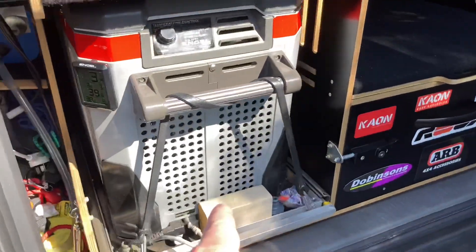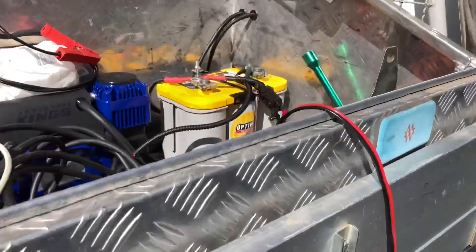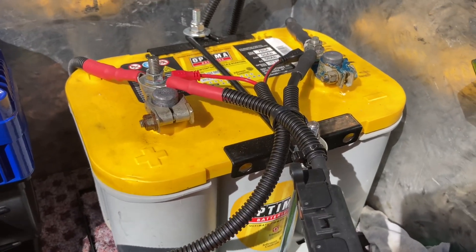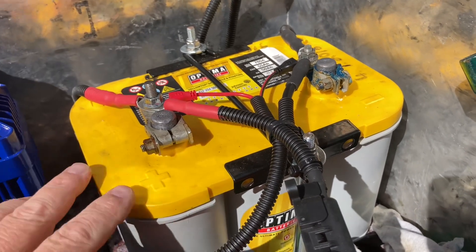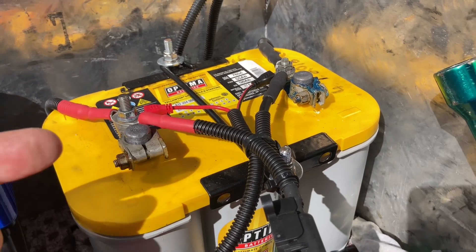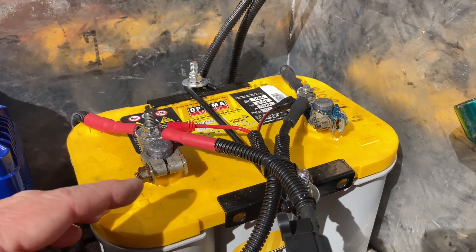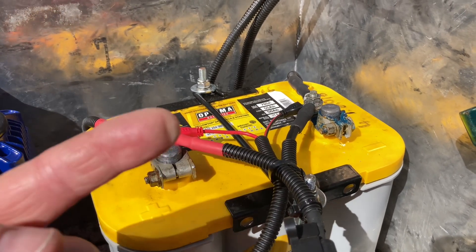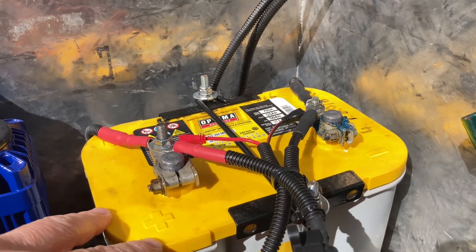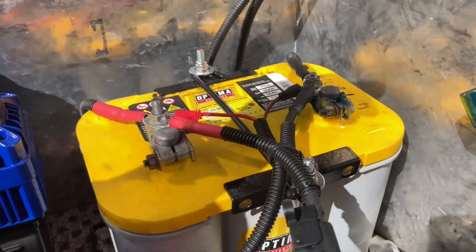So the 120 - there's the fridge, it's not running at the moment. You'll see a voltmeter telling you about the same thing: 13. So what's happening at the moment is we've got one set of solar panels on the roof over there, and it's charging three Optimas plus that black battery that I'm not a fan of. Eventually it'll get replaced, but it's still working. The Hilux has got a winch on it now, so the load's going to be on that battery. If the other one drains too much it's going to disconnect, which is not ideal - what we really want up front is a big fat yellow Optima or something like that.